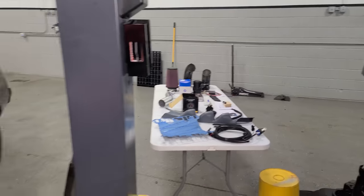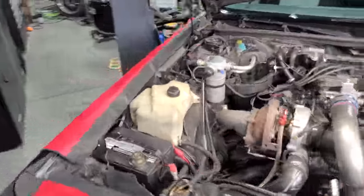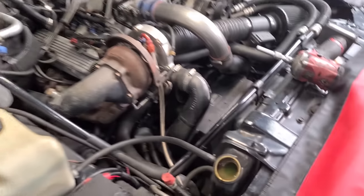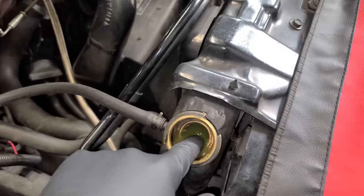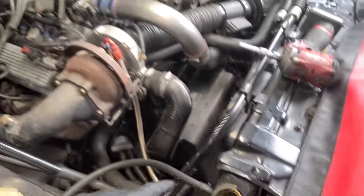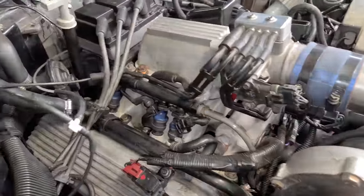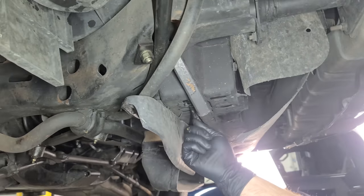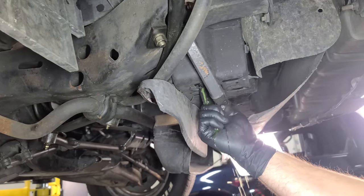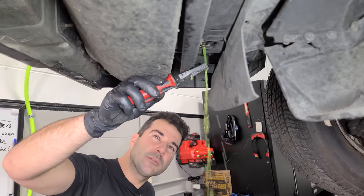The Grand National is ready to go on the rack — we're prepared to perform some surgery. First we have to drain the coolant. We haven't done a coolant flush on this thing and it's a bit dirty. We don't know how long it's been in the engine, and we're starting off by removing the intake manifold, which requires draining the coolant. It's green and a little cloudy, but not too bad. Glad we're doing it anyway.